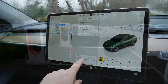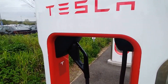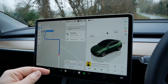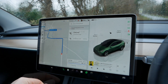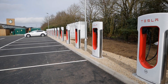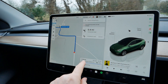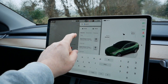When I arrive at that Supercharger in 25 minutes the battery pack will be a bit warmer and therefore it can charge a bit quicker. The whole point of that is to maximize the efficiency of the charger site - you're not hogging that charger for a long time, so you free up that stall to allow other people to charge their vehicles. Tesla implemented this so their charging sites got more efficient and they could have a higher throughput of cars, charging more cars without installing more stalls or new charger sites.